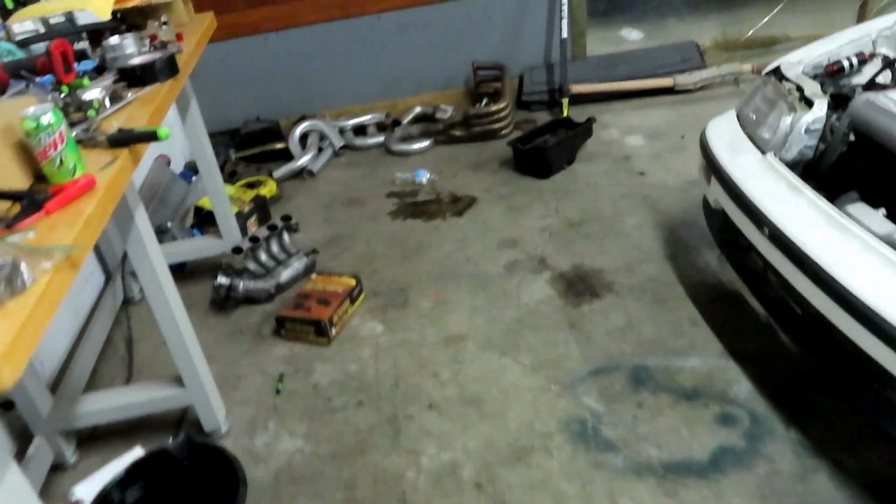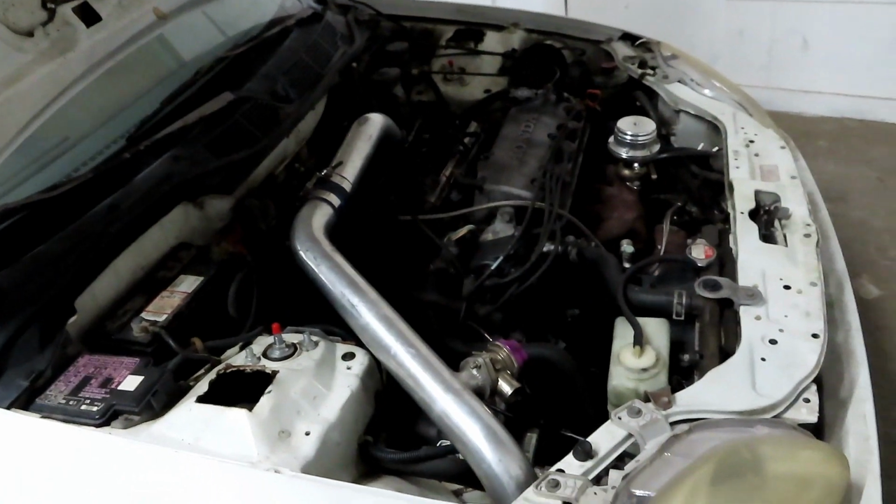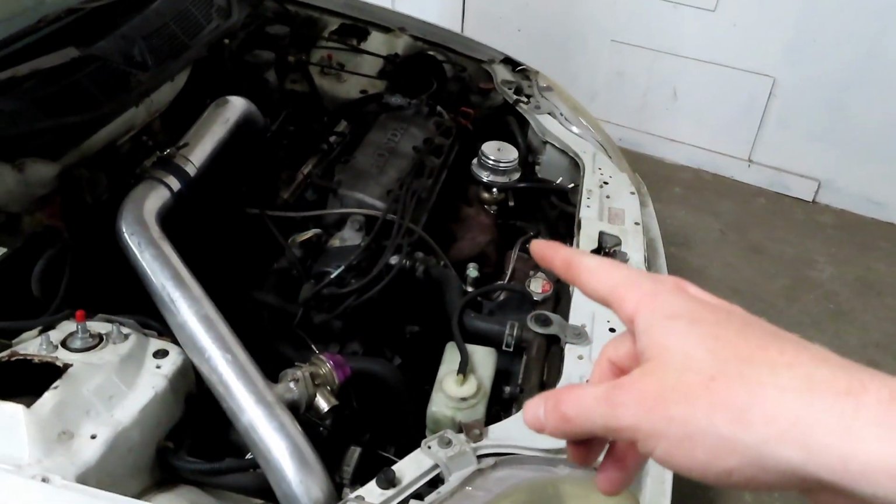I was looking at my pickup over here, the one that came on the motor, and we are not going to be using this because I don't know if you can see on camera really, but there's a whole bunch of metal shavings in there. It's going to take forever for it to get out, and then I don't want to run the risk of it clogging up again. So we're just going to go ahead and get a new pickup. I might use the pickup off this motor. I'm pretty sure it fits. It does fit. I'll probably use that one once this motor's blown up, if there's no metal shavings in it. But anyways, we'll figure it out. Those things are pretty easy to find. These D16 motors you can get pretty much anywhere, so not really worried about that. But anyways, I'm gonna go ahead and get that on.